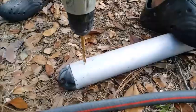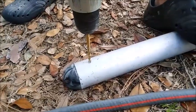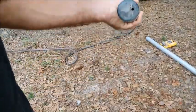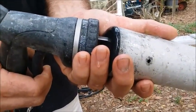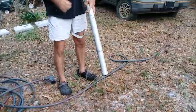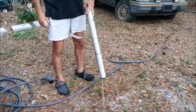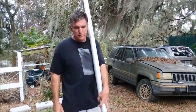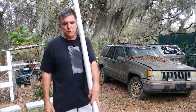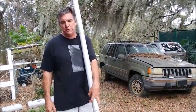One of the things I've done to correct this: go and drill a small hole into the side of your mast up at the top, and into the plastic on the bottom. You can see where I'm taking the hose and filling the pipe up inside, then we drain the pipe back out to get all the salt residue out of there. This will extend the life of your aluminum mast significantly, especially if you're sailing in salt water.